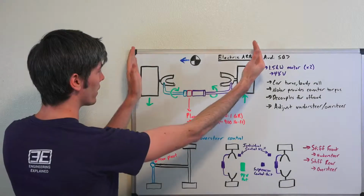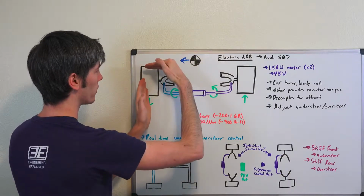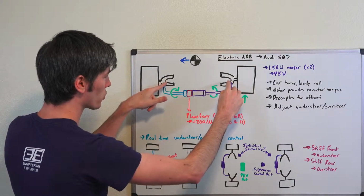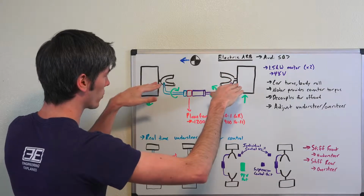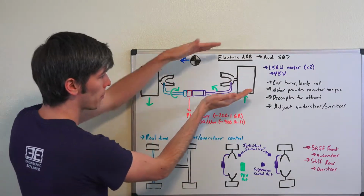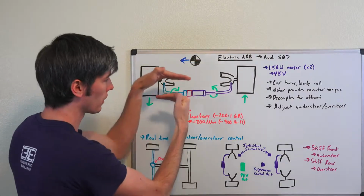So you're going around, it's compressing down, and because these two are coming closer, you want to push this wheel away from the body. So the body's trying to compress in, and then the anti-roll bar is going to be twisting. That electric motor is going to try to rotate this downward. It's connected to the control arms, so the control arms freely pivot, but then the anti-roll bar is connected to both, so it connects those two sides. So it's going to try and press down that side, which is going to push it away from the body, or the other way you could think of it is pull up the other side. So the other side of the body is trying to get away, and it's trying to push that wheel up towards the body so it flattens the vehicle out, and the vehicle remains flat through that corner.